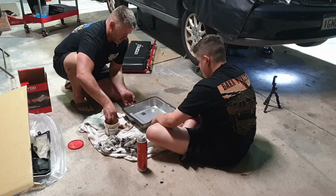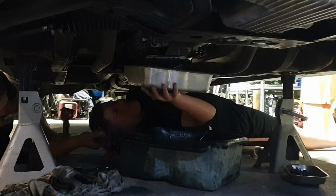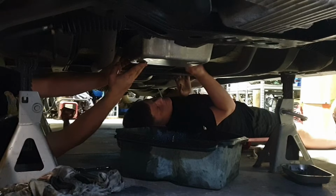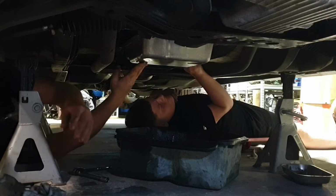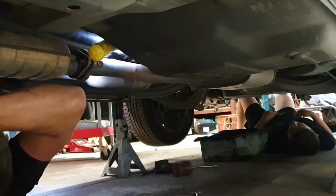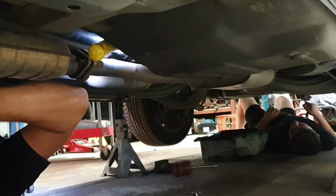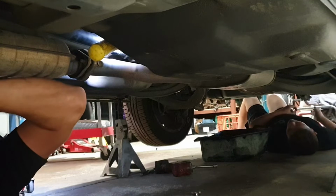All right, put the filter in, smash that back in. Like this. Yep. It's got to go that way because the filter at the front. So start them all by hand and then look around the transmission pan and make sure that gasket's in, okay? Okay, Dad. Okay. No worries, mate. I'll make sure. Which one do I undo first, Dad? Well, you're better off undoing the filler plug first, because if you drain it and you can't refill it, what happens? Can't refill it. That's right, so undo the filler plug first, bud. Okay.